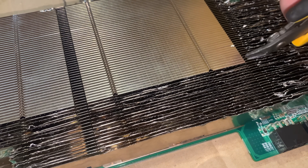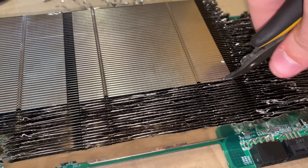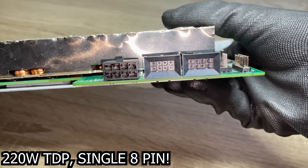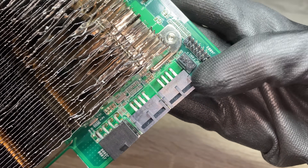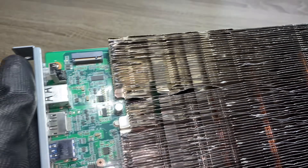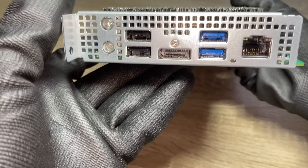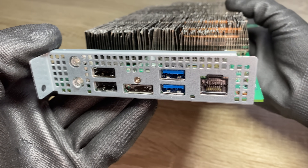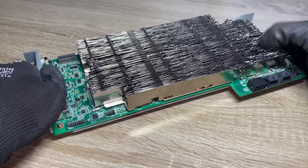The radiator is not supposed to look like this — I vandalized mine for a reason, but more on that later. As for power and ports: it powers with a single 8-pin GPU connector; two others are proprietary and not mandatory to run the board. On the board there is a CPU fan connector, CMOS battery, and an NVMe slot, but it's only PCIe Gen 2 with only two lanes. The IO features two USB Gen 2, two USB Gen 3, one gigabit ethernet, and one DisplayPort. Power and reset buttons are included.